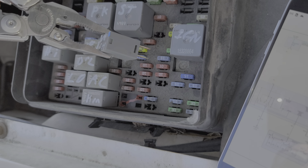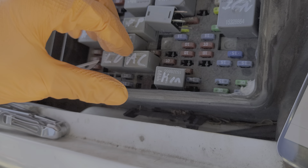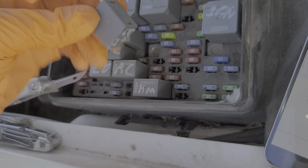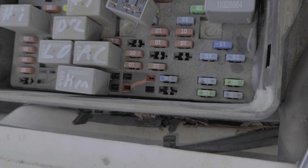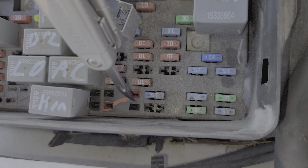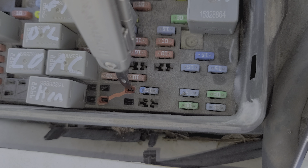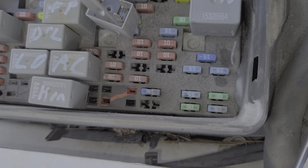We can pull this relay out and set it aside. If your horn works, you know your horn relay works, so we could try putting the horn relay in the position of the washer relay. If after switching the relay the washer starts to work, then you know the original relay is probably no good. You can also manually send power to the washer motor by connecting these two pins together — take a wire and connect those two pins.